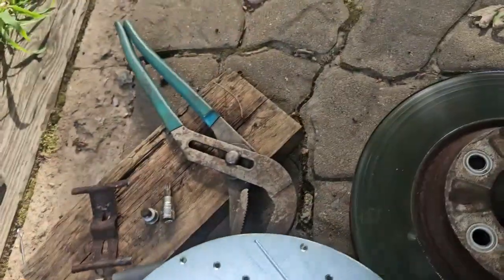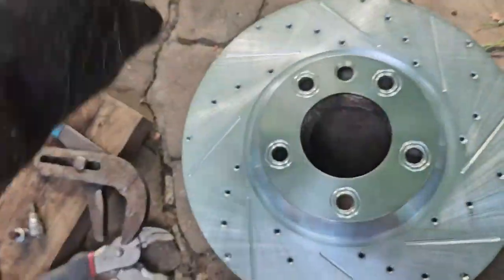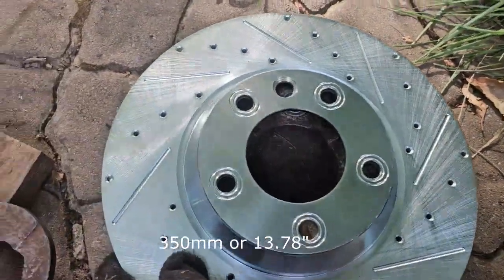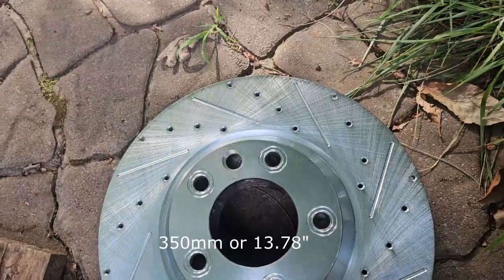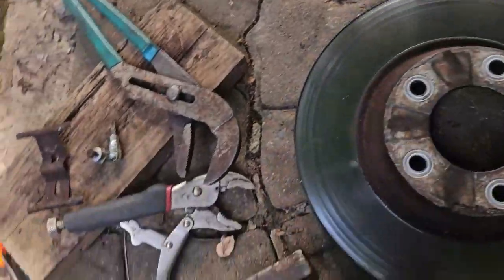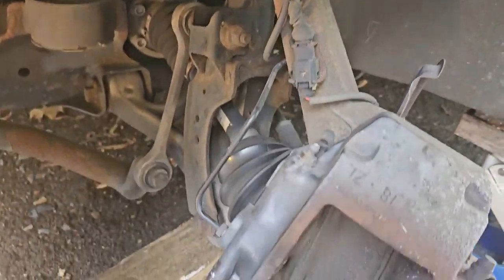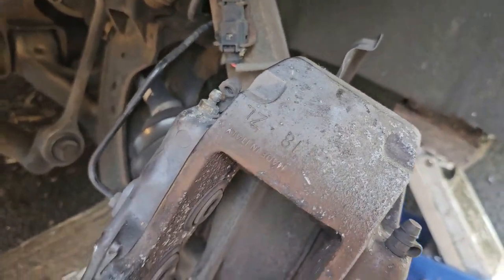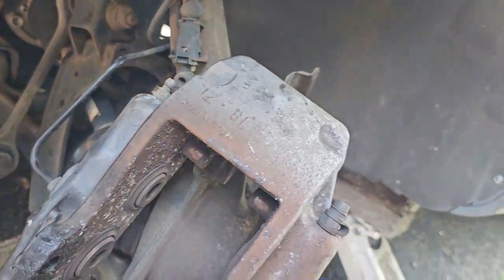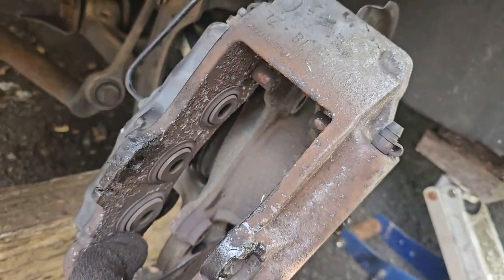Let's do the matching ceremony of the pads — they look about the same. The rotors are 13.78 inches. I haven't disconnected the brake line or anything; there's enough play in it. You can move it once or twice and it's not going to break the line, but if you do it too many times you might as well get ready to change the brake line.